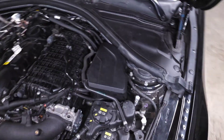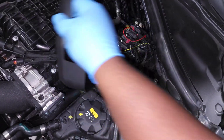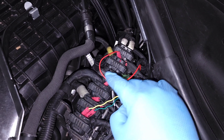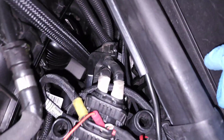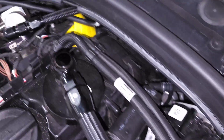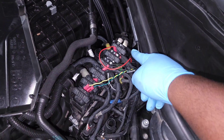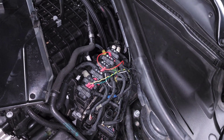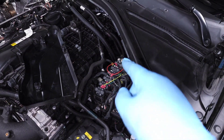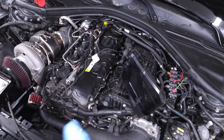The new thing I've started doing that's a little bit easier is unplugging connector 6 on the DME. You take the DME cover off and count: 1, 2, 3, 4, 5, 6 — it's the last connector at the back of the DME. When you unplug this one, you can follow the wiring harness and see that it goes to your entire ignition system — power for all your coil packs, all your injectors, basically everything along that wiring harness. You might have to remove the front five connectors to get to this one, then plug the other five back in. Unplug that number 6 DME connector and it'll make sure nothing fires — no spark, no fuel — and the engine will just turn over.